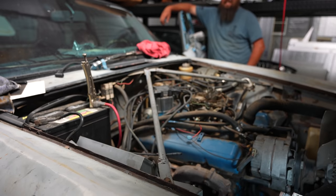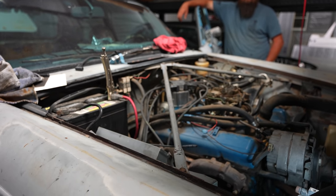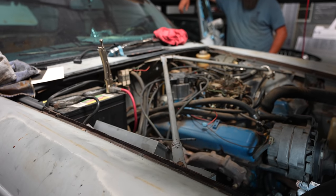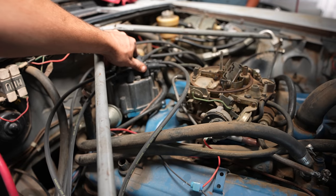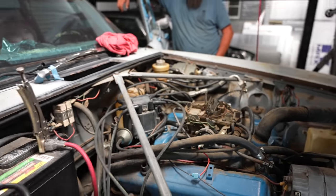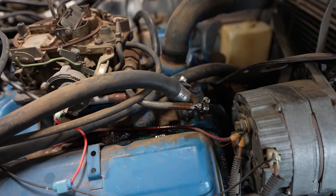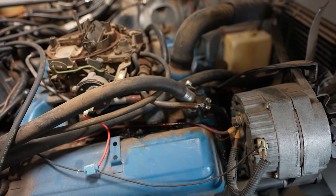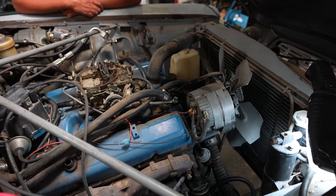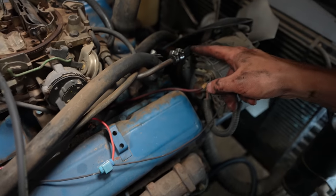I'm not working the carb so hard or the starter so hard. All right, go ahead - it was just a little drop, not much at all. Go ahead and try it. Just pump it a bunch of times and let it start and see if it wants to idle. We definitely have a fuel leak so at least I know we have fuel there - we're probably gonna need to replace that whole line. I'll try to get it sealed tonight. Oh that thing sounds excited! A little bit later and now we have a nice piece of AN line coming up to the car.